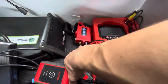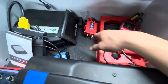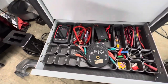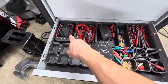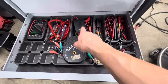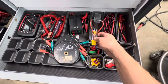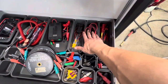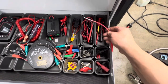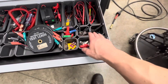I've got my Thermal Imager Elite there, and then this is the WPS kit — there's my WPS 500 for pressure readings, pressure sensor, my multimeter, and I've got two test lights: an LED one and an incandescent one. And the command circuit tester from Jarhead Diagnostics, a couple of fused loops for doing amperage testing and such. Some DMM leads, some piercing probes, some terminal probes or connectors, some back probes in there, and a bunch of alligator clips.